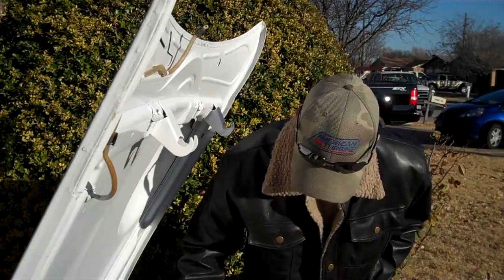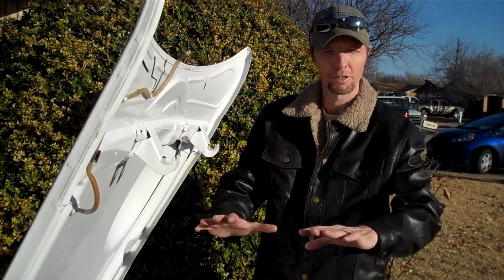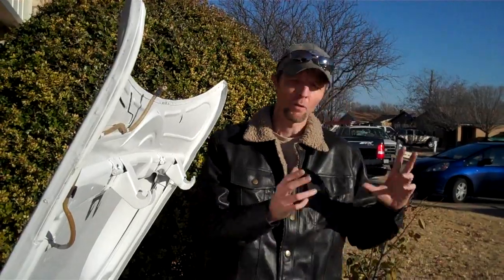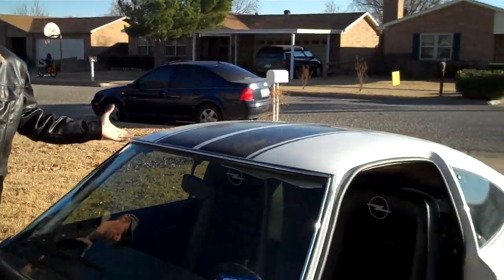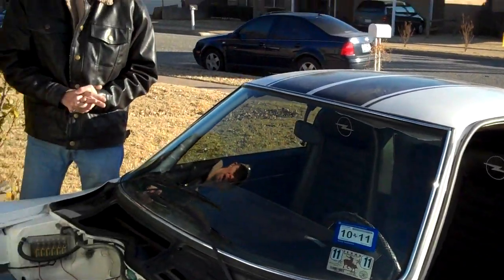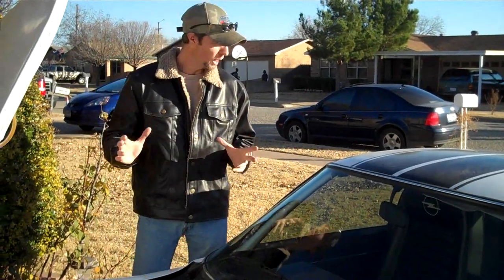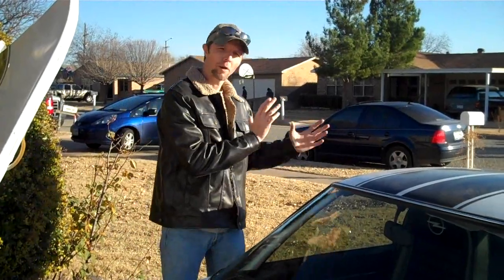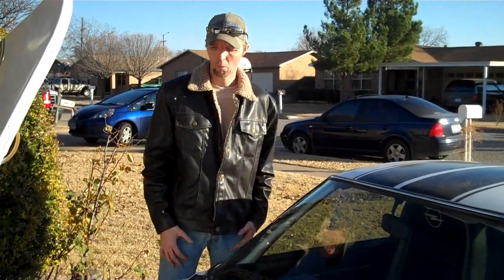Because the electric motor is so much lighter, we had to remove one leaf from the front leaf spring to set the car down a bit. In the rear, it's a little different — we added batteries and added about an extra 200 pounds back there. The battery pack weighs 360 pounds, so we had some special coil springs made to handle the extra weight so the car sits normally. It really helps performance because you're putting all that weight right above the rear wheels on a rear-wheel-drive car — it just works perfectly.